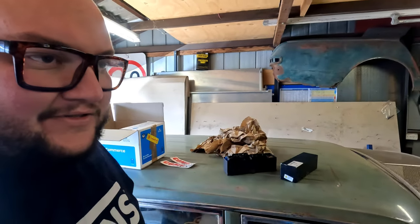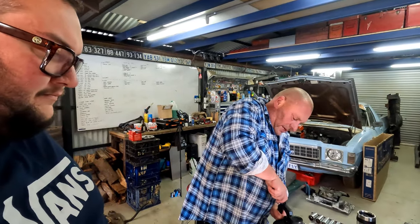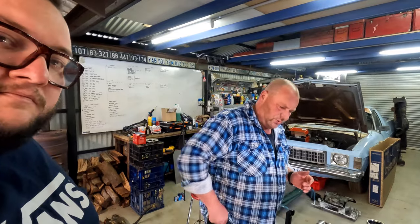We're back again. We've got the radiator lifted up, and now Dan is here. We had some overnight parts from Albury — we've actually got brand new lifters. Massive shout-out to Engine Masters — they helped us, looked after us immensely, got those sorted with Comp and internally with themselves. Dan's cutting a little bucket open and we're going to soak the lifters. Dan likes to use ATF — it's a very high temperature lubricant, so that on initial first start-up of something it's just nice to have it as lubricated as you can so you don't wear out bits too fast. We'll get the lifters in, pushrods back in, top end reassembled and see how we go.